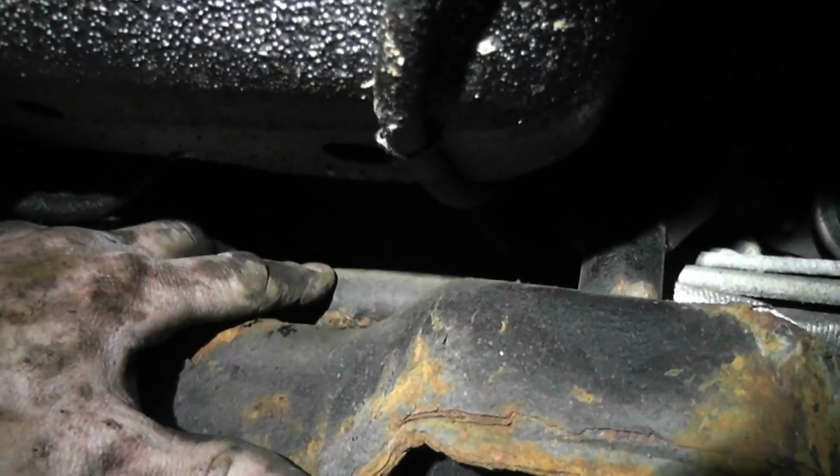AKA spit. Okay, I'm gonna show you guys. Head back deep in the bowels of this car. Okay, so we're like right under the car now. Alrighty, so this is part of the frame here. There's a motor mount bolt here, and there's 2 motor mount bolts in front of it. But on top, you can see this bar here. That's the actual sway bar. In front of the sway bar, they have hidden the nut that takes the steering rack out. So, yeah, they've hidden the nut back here to get the steering rack.